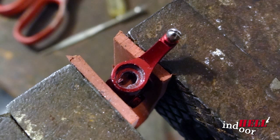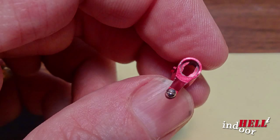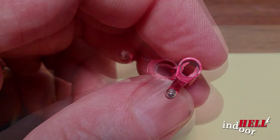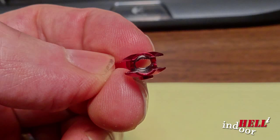I couldn't believe it. It was like, is it glued in there? Is it, you know, welded in there? So I had to decide what to do. I had to do something. So I ended up taking another radical approach. I then proceeded to the other side of the grip and started filing it down so that I could actually cut the race in half so there would be no way that it could stay in there. To my amazement, it still stayed in there. Now I had two halves of the race on that backside.